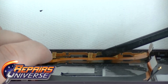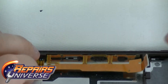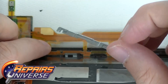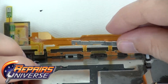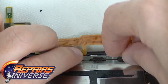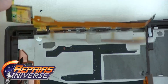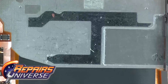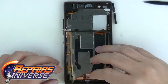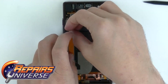You're going to see these little plastic guide holes — these hold the device in place and give you a diagram of how it lays. Once you have it in place, grab that metal bracket and look on the left — there's a little cut or teeth connection that goes on the left hand side. Once you get them in place, you can bend it back and slide the metal bracket where it needs to go. Once you have everything set, push down the bottom with the mic connection and line up the flex.